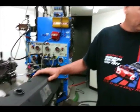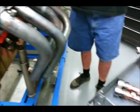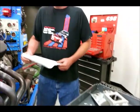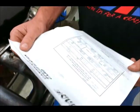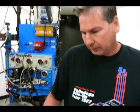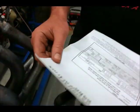Steve, tell us about the cams we're going to be testing. Basically we've got a very typical street-style motor — it's a 454 Chevy and we're testing three different cams: small, medium, and large. With any camshaft you get a cam card giving you all the important specs. In this case we've got 222-230 duration for the small, 234-242 for medium, and 248-256 degrees duration at 50 thousandths for our big cam.